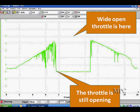We're sweep testing like we always do, going up and down. We put a marker at the top that says this is where the throttle is wide open — we had to do that because you can't tell from the signal. We had to tell you when it went to zero the throttle is still opening. So we went up and then back down smoothly. This is the worst sensor we have ever, ever seen — but it shows you how bad sensors can be.